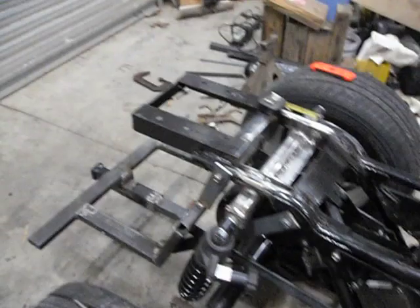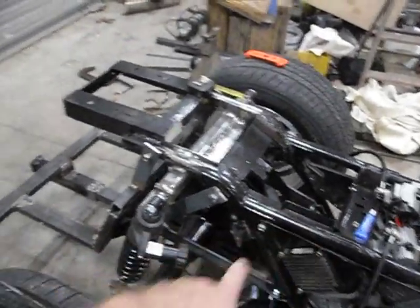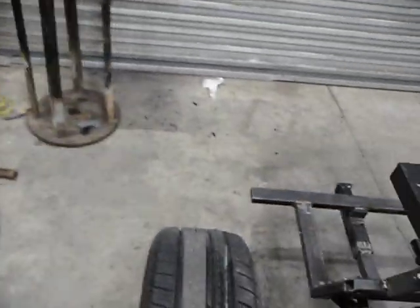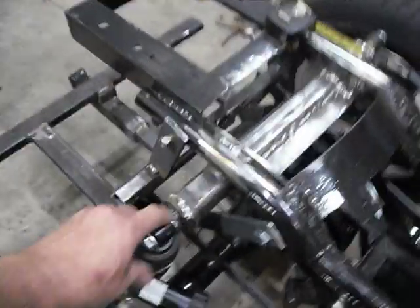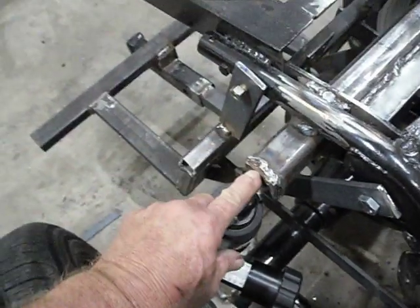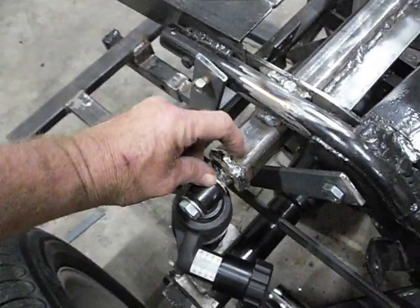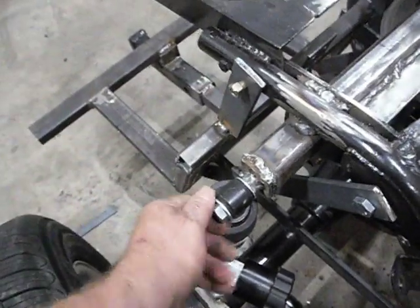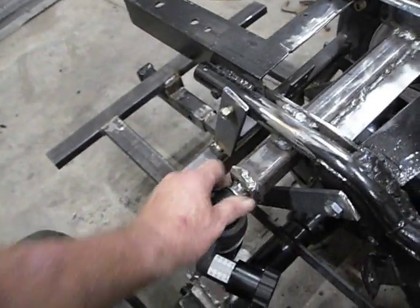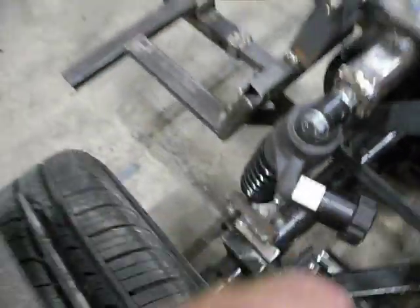That is more than enough to hold this little exhaust on. If you look at my support, I put the battery under. I made these tubes — this has a nut on the inside and the outside. I was gonna have one for this but anyway, just weld your nuts in place. This is a plate — I tapped it and there's a nut on the inside, so there's one inch of meat to screw your bolt in. Put your red Loctite on and there you go.